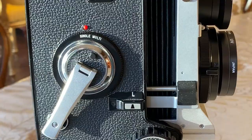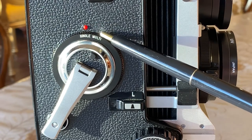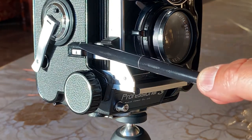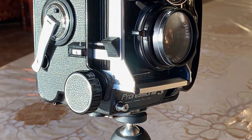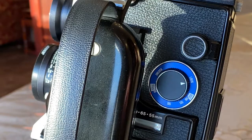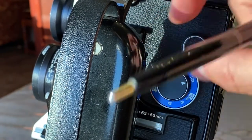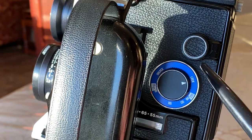Once you've loaded the film, make sure you're on single exposure rather than multiple exposure unless you want a multiple exposure shot — I don't do very many of those, particularly not on film. You'll also notice there are two shutter release buttons: one here and another that doubles as a cable release, depending on what position you're holding the camera in. On the left-hand side of the camera, there's a little red dot that you set with this dial to the correct lens you're using on the Mamiya. Also make sure this is set to lock once you've changed or put a different lens on, so it doesn't come off the camera.